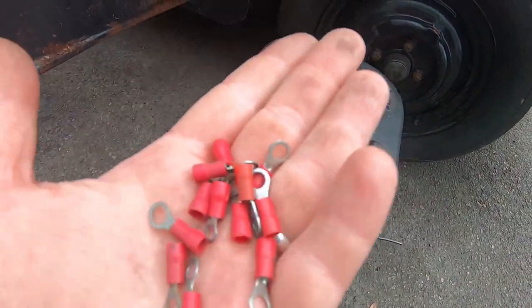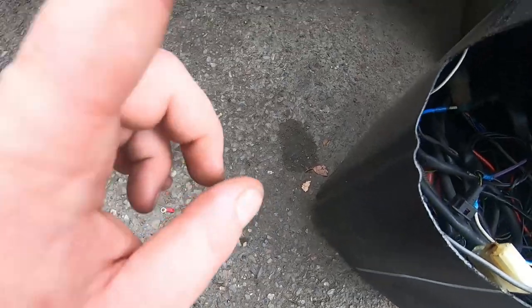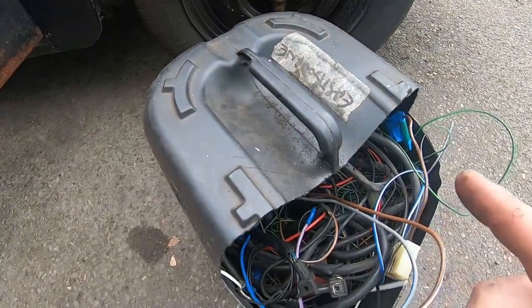I've got a handful of ring terminals. Annoyingly, these aren't as small as the ones I'd like. I've only got one really tiny one which will fit the gauges, and then all the others have got to be these bigger ones, but we can still make them work. This here is a bucket full of wires - this is all the wires that came from the midget conversion that were left over, and a few others that I've added in. So I'm going to fish out two different colour wires so I know which one's for the oil pressure and which one's for the temperature as I run them through. And if I haven't got enough red wire to do the positive side, I have got a new reel in the workshop.